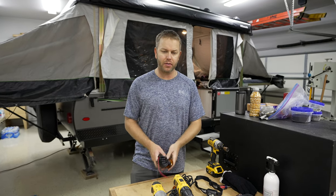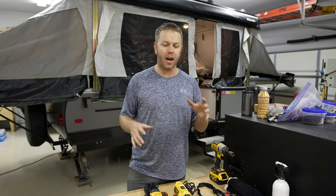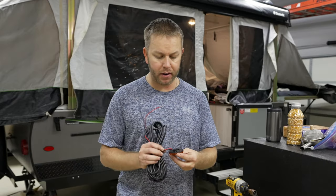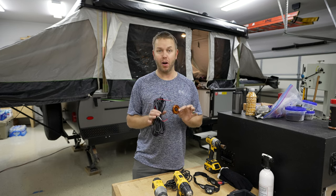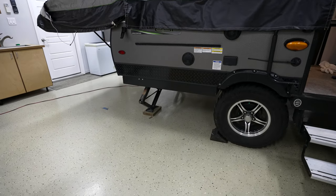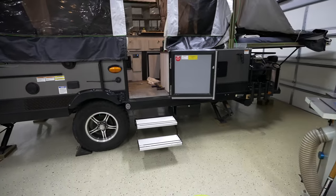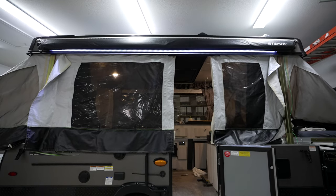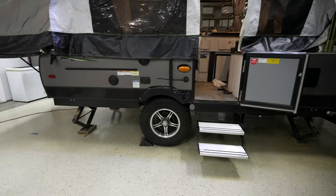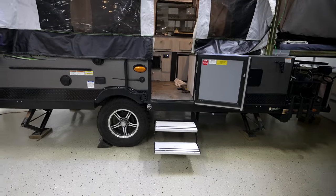The magnetic option is one of the main reasons I chose this light. I also wanted an amber light and didn't want a bunch of split-offs with a computer module and remote — I just wanted to buy one, two, or six lights individually. The main reason is that it's magnetic, so I don't have to drill into the chassis. I'm going to put one light in the back and one in the front. These are kind of a flood undermount light. That light bar is nice, but when you're boondocking it draws quite a bit of power. These undermount lights are going to be perfect after dinner to conserve battery while providing ambient light around camp.